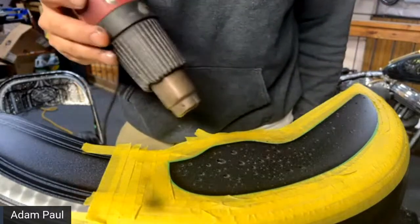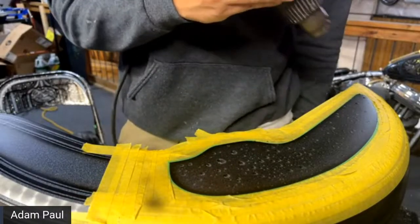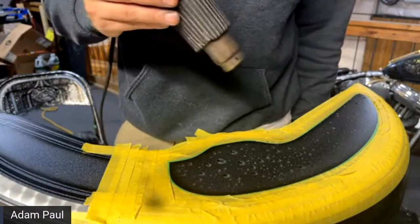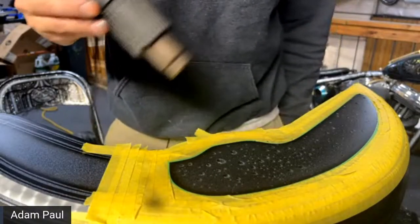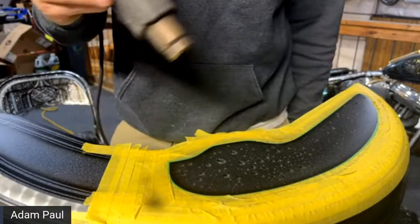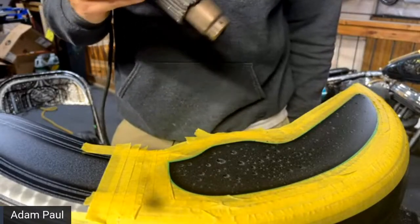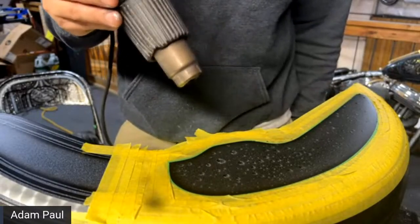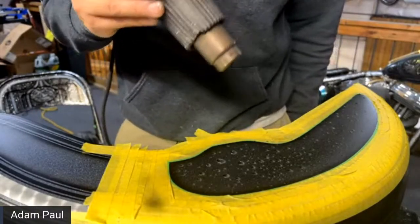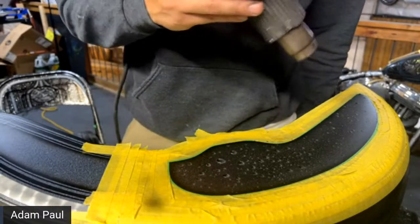And then someone said, I see you use U-Pol Clear Coat a lot. Is it just a good performance for price thing, or do you just prefer it for quality? So I prefer it because it's the best clear that I've found so far that can take layering over and over again. It dries fast. I mean, literally, I can clear it the next day. So I'll do some graphics, I'll clear it that night. The next day I'll wake up, sand it, and start another layer of graphics, and then it'll go back into clear that next day. Some clears, they'll trap solvents.